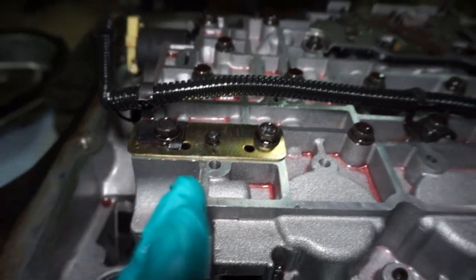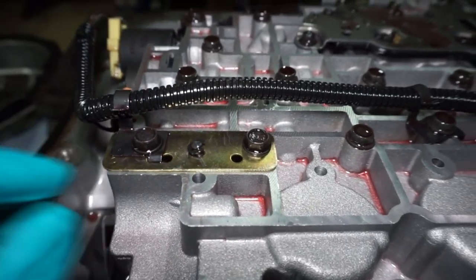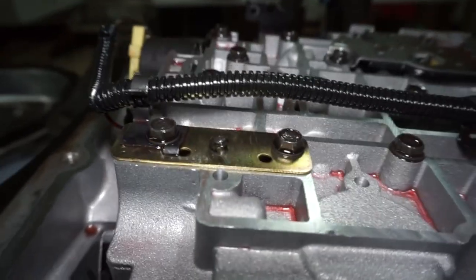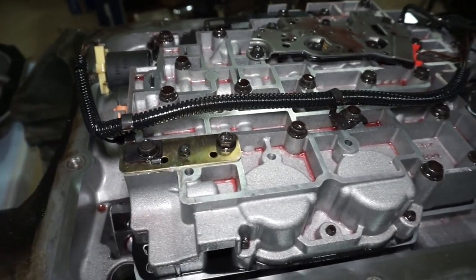So on my HD2 kit video, the last one I did, I recommended not putting that in there. You can see how that valve is actually in there crooked. This one is fully sealing, but you can see how it's crooked. The issue with this thing is this little spring pin just plugs a hole, so if there's any play back and forth or that thing gets stuck sideways, you can actually lose pressure in the transmission and cause it to burn up. This one ended up being okay, but I thought that was interesting.